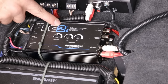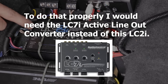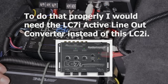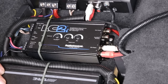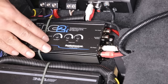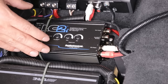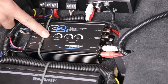I was originally going to use the active line-out converter to drive the Alpine, but I realized it only has two channels — left and right — and the Alpine is driving four speakers. I didn't want to lose my fade functionality, so I left the Alpine with a high-level input, which works great anyway. The LC2i was worth it for my setup because the rear channel in the WRX is heavily attenuated, and this active line-out converter cleaned that up.